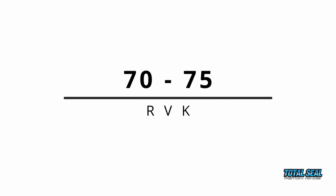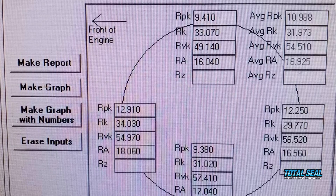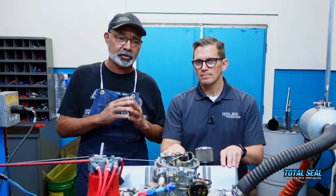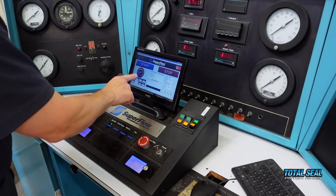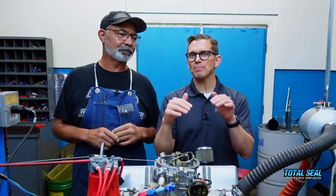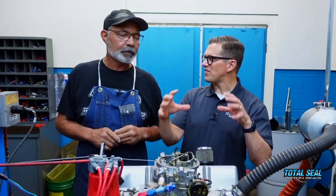We measured it yesterday. The RVK on this cylinder now is about 70 to 75, where before we were like 45 to 50 — so we added more valley to it. We also took that peak height from somewhere around 5, which is really too smooth, and now we're in that 10 to 15 range. A little more valley to help hold oil, a little more peak to help the ring seat in. That's very important — the first 30 minutes of the ring break-in procedure, it's critical for that finish to be correct. Essentially, last time we made a little mistake — we were in a hurry and the finish was a little bit too smooth for that ring combination. Now we should have the right finish.